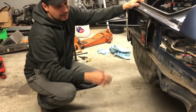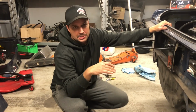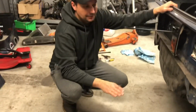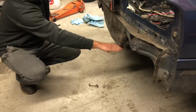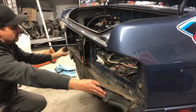The pull points in that location are really low on the car. A lot of people were telling me that it's way too low. It's going to pull and lift up on the back of the car, which you definitely don't want. So I moved it up from below the car about 8-9 inches to be more center of the car, and it's actually going to be pulling from where the frame rails are in the unibody.